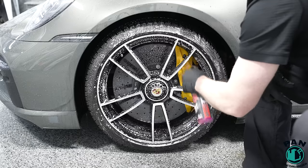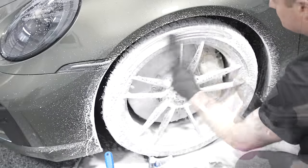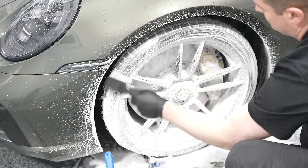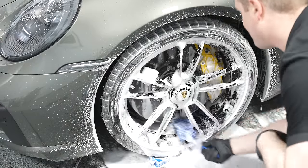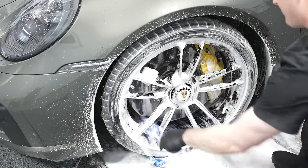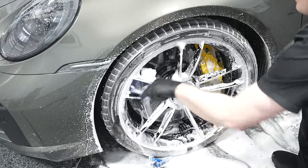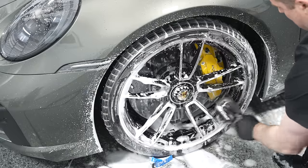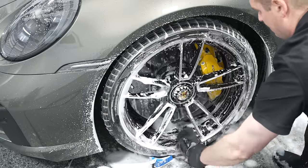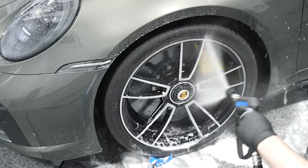We're not looking for anything super harsh here — no harsh soaps, no crazy alkaline high-pH or acidic shampoos for deep grime removal or spring cleanings. Just regular maintenance washes. For wheels and tires you can use a separate tire cleaner and a separate wheel cleaner, but I prefer a two-in-one: P&S Brake Buster. This one often takes first place in my tire and wheel cleaner comparisons. It's very inexpensive, available in bigger formats, and you can dilute it in a foaming pump sprayer at 1:3 to 1:5. Still safe on ceramic coated wheels — I have ceramic coated wheels and use this all the time.